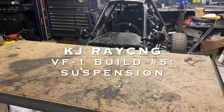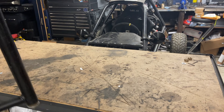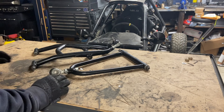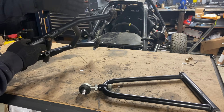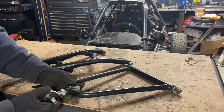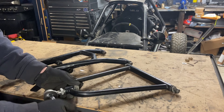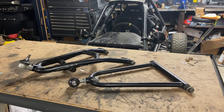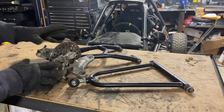All right, let's talk suspension. I said we were going to make this a full-on race cart — well, full-on race carts need adjustability. So I picked up these A-arms second hand. You can see this has a lowered shock mount, a little curve in the lower A-arm, and the upper A-arm is adjustable so we can adjust camber. We're going to have to rip our tabs off, mount these up, and the front end should be done. I'm still going to use the Polaris Outlaw front hubs.